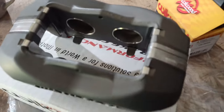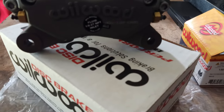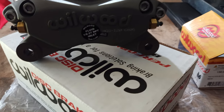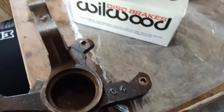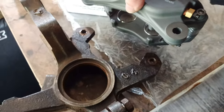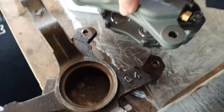The caliper is four-pot and it's lug mounted. As it happens, it fits really well. One hole needs to be slightly enlarged on the caliper just to reach across to the thread. Sorry about the camera shake.